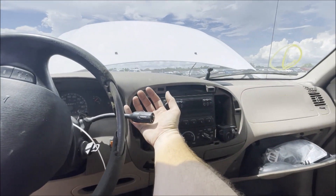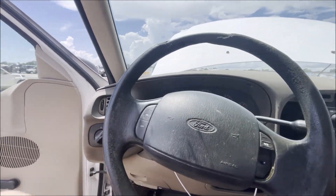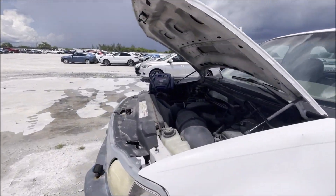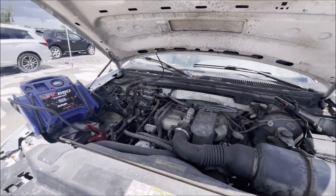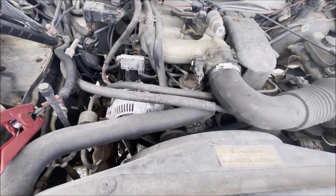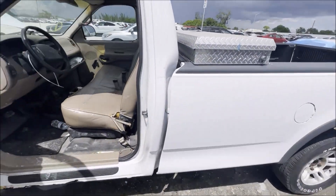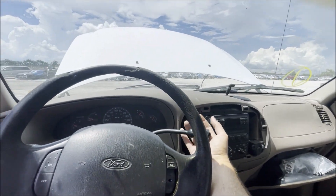We may actually have cool air. Got power steering. I'm pretty familiar with these older Ford trucks - these bubble body Fords. I've bought and sold a lot of them. I've got a '01 with 315,000 miles, a 5.4, I've had it forever. The AC does work - you hear the clutch. It's low, that's why it's cycling the clutch so much, but it is blowing cool. Obviously there's a minor leak somewhere and a top-off of Freon is required.